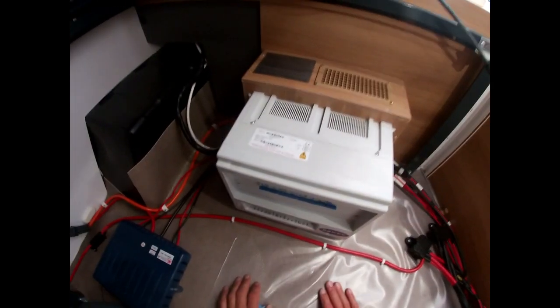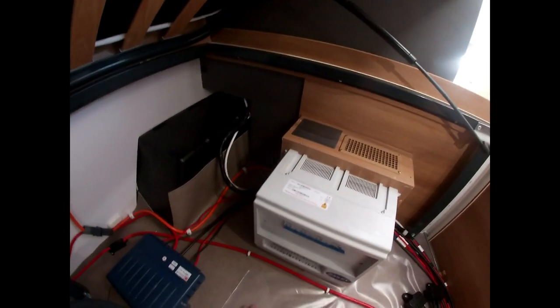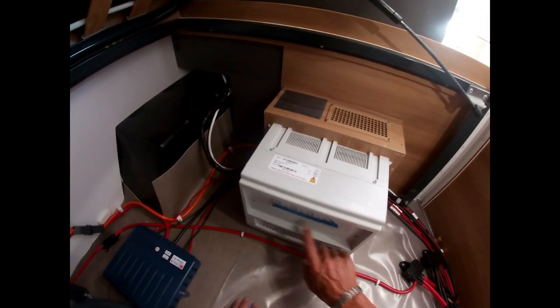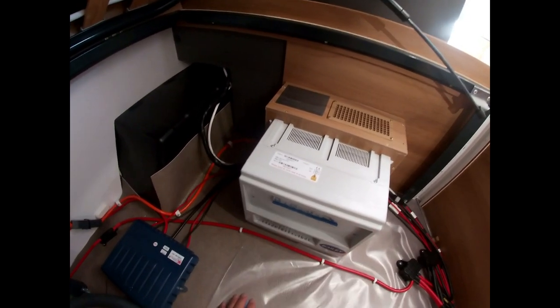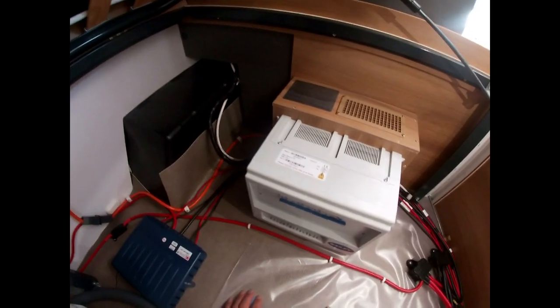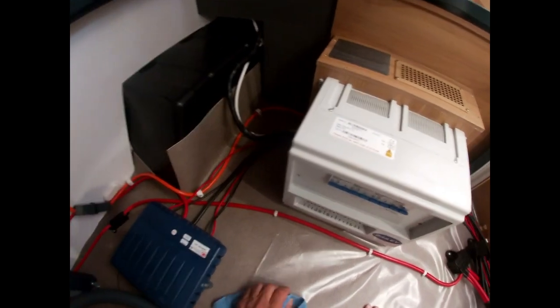So if I've got something on 12 volt not working, that's where I need to look. I then come up to my 240, which is identified as my charger, my boiler, sockets, etc, and that's my master RCD with my 3 MCBs. Okay, so very much like your domestic one at home, if any one of those are tripped, then you know we come and reset it.